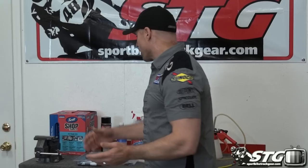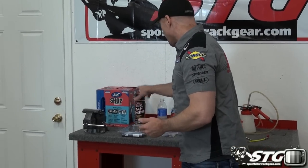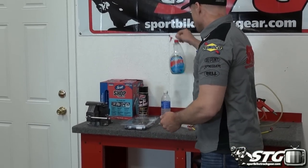If you don't have a power bleeder to suck all the fluid out of the system, a good substitute is a turkey baster up on your master cylinder to empty that — it gets most of the fluid out of the master. But be ready to clean the brake fluid, because this stuff is nasty. You get it on painted surfaces and it can make a mess, so be ready with rags. Brake fluid is water-soluble so it cleans up easily — just don't let it sit on a painted surface.